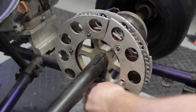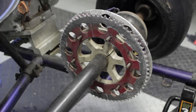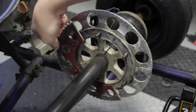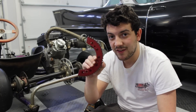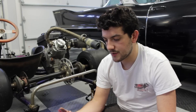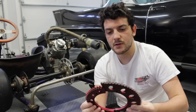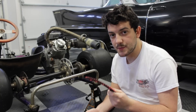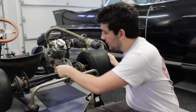Once the sprocket guard is off you can take off the sprocket. I just took off this 69-tooth sprocket in favor of this 58-tooth one because right now I want speed over acceleration. As you can see there's a pretty visible difference — here's the 58, here's the 69. To put this smaller sprocket back on we just put it on the same way we took the other one off.